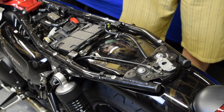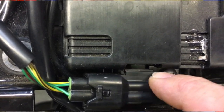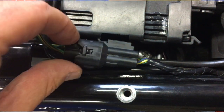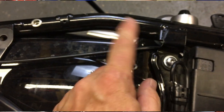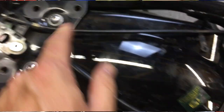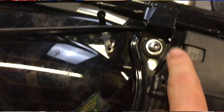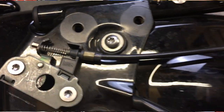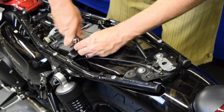First thing you want to do is disconnect this plug here. There's a small toggle that runs in the side — you can't quite reach it with your fingers, so just lever it off with a screwdriver and it will slide off. Then you've got a clip here which holds the cable for the release, so that just unpops. Unpop the other two as well, and then it's just a case of undoing these four bolts with captive nuts in the mudguard itself.